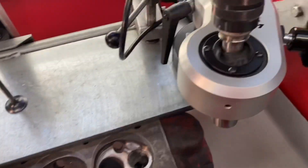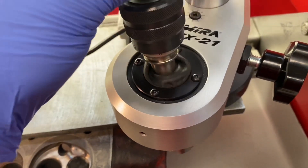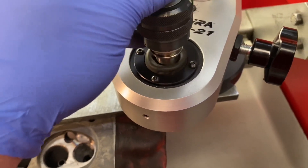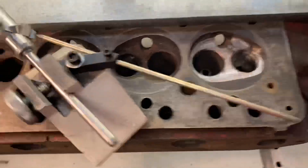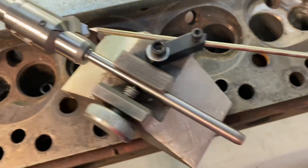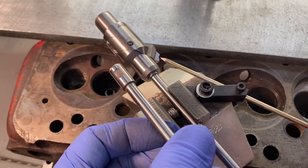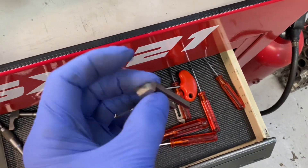It is very similar to the older Myra systems. It has a ball that's hydraulically locked with this wheel here, but it also allows the ball to move laterally as well. It uses a pilot system which is held in with a grub screw — I think it's the FG series pilot, so they've got a flat which goes into that section there, available in different sizes, and uses all the normal Myra cutters.